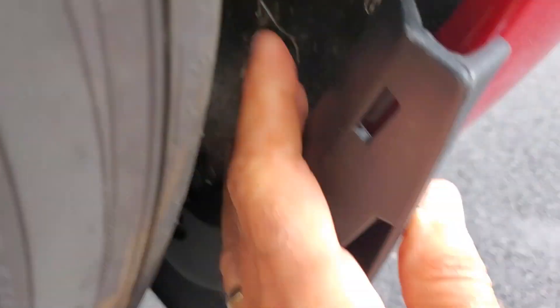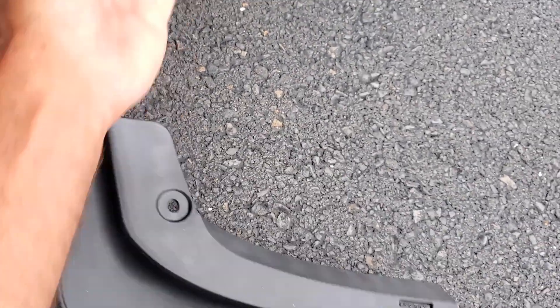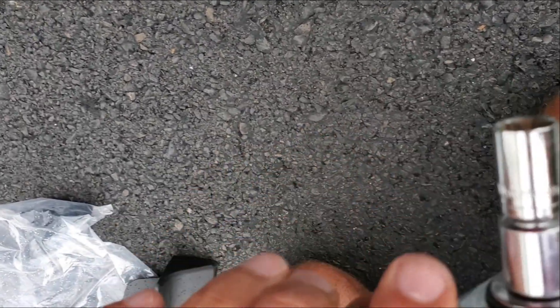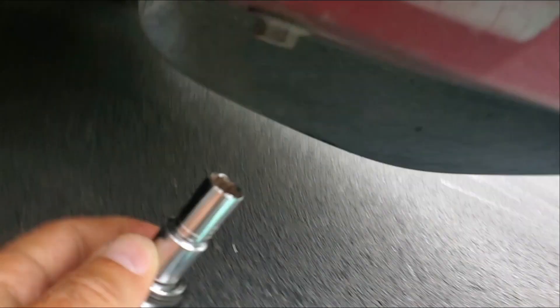Here's the back one, and it just slips right in here. It slips in like that. Looks like this top piece is just going to clip in to catch the metal, so we're going to figure out how that clips in there. There's a hole here and a hole there, so there must be something underneath. I can feel a screw underneath there. Looks like we've got to take this bolt out and then mount into there. I suspect this clip is going to come out right here — put in a new clip. Looks like we are using a 10mm ratchet to take this bolt out.